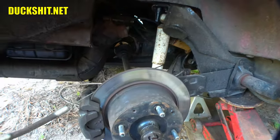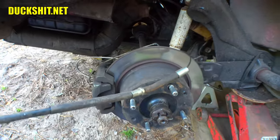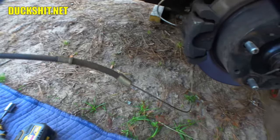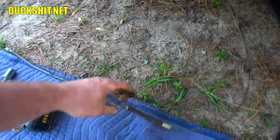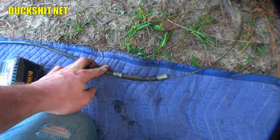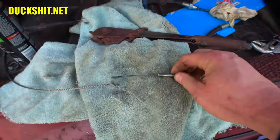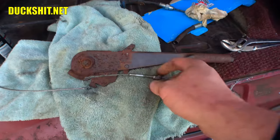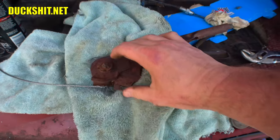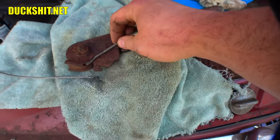This should just pull right out of the chassis the entire length of it. I grease these things up, so when I pull it out I've got to be careful I don't get it all over my body or the brake disc. This little piece here is an extension I made because this cable was intended for a Beetle, not for a Type 3. I think my new cable is exactly the same way, so I'll be using this little piece again. The cable broke up high, just behind where the e-brake lever lifts up — and I'm guessing that was our friction point where it chewed the cable up.